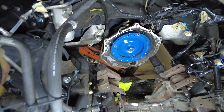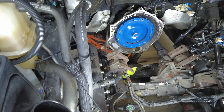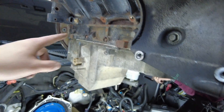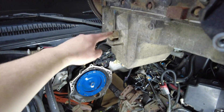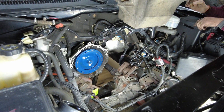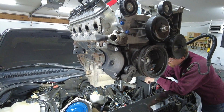Those things were a pain in the butt. We tried taking the three bolts out right there on the front, and I think they had a little rust on the back side because they were incredibly strong. We had a huge five-foot breaker bar on them and couldn't get them out, so we ended up having to take the four bolts off of the engine mount to the block — and that was the easiest way. Then trying to bring it up, the front little corner lip kept getting caught on every little ridge as we were raising the engine. I definitely should have started pre-soaking those bolts ahead of time. But we didn't tear any harnesses — everything was up and out of the way — so I'm pretty happy with it.